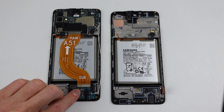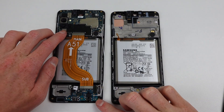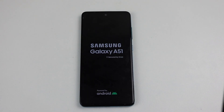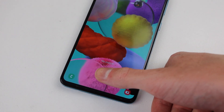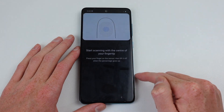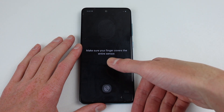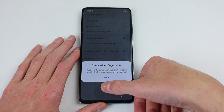I can swap it across to our other display panel and connect everything back into place. I'll label the fingerprint sensor BK for black and the other BE for blue. After reconnecting the battery, we can test out the phone. As we programmed our fingerprint in earlier, theoretically it should work just fine — but that's where we're wrong. Instead, every attempt displays a no match error. In settings, I can try to add another fingerprint, but instead of registering, it says to make sure your finger covers the entire sensor — which I'm clearly doing. Checking the fingerprints, nothing shows up.